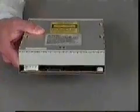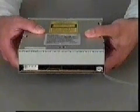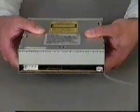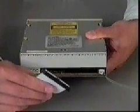Now we will connect the cables to the CD-ROM drive before we put it into the drive bay. The two cables we will be connecting are the ribbon or data cable and the audio cable. The audio cable is the smaller of the two cables. It does not matter which end you connect to the CD-ROM drive, but it is important that it be put on the correct way. It can be installed only one way, so do not force it. If you are having trouble sliding it onto the connectors, then turn it upside down and try again. The data cable is the larger cable with 40 holes in each of its connectors. It does not matter which end you connect to the CD-ROM drive; however, the connector fits into the drive, and eventually the sound card, only one way. Do not force it. If the cable is not easily sliding into the connector, then turn it upside down and try again.